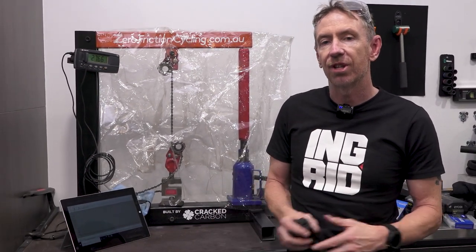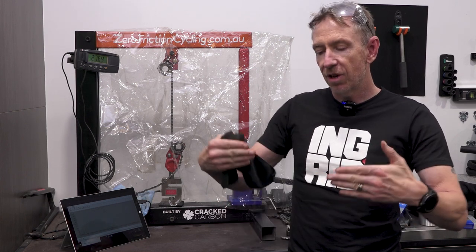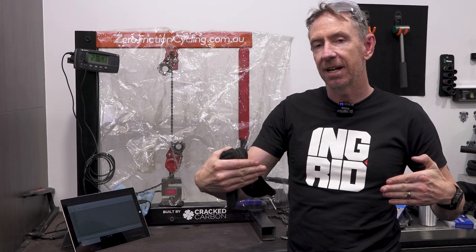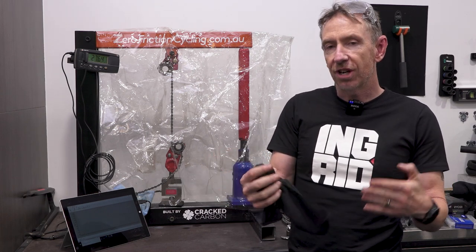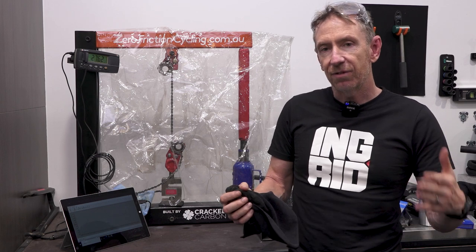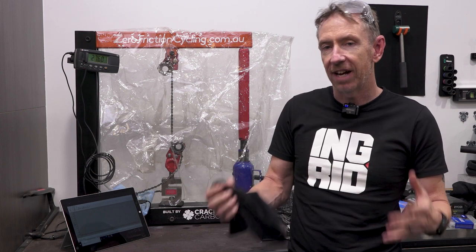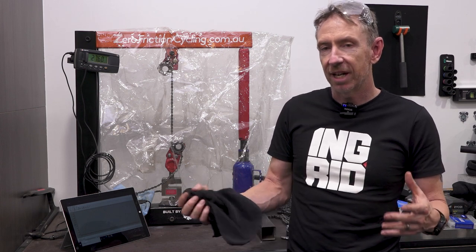So depending on how that pickup goes, there can be a split second where, if the pickup's not great, all of your pedaling load is going through one tooth and one link. Especially if you've got any sort of chain line angle happening at that time, you're just going to pry the outer plate off the rivet. And so shifting from small to big under high load is probably the highest failure rate for your derailleur chain.